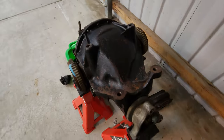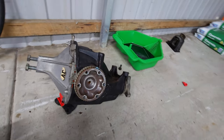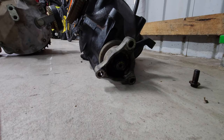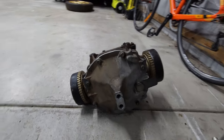It's the next day and I've done some long hard reflection and research regarding the diff situation. Things are going to be slightly different than what I anticipated. From what it looks like, the diff that's already out of the car — or the other diff that came with the car — I think that's the original diff. However, the things that the axles bolt onto have been transferred to the junkyard diff, and also the thing that the driveshaft bolts onto — I think it's called the mini spool — has been transferred to the junkyard diff as well.